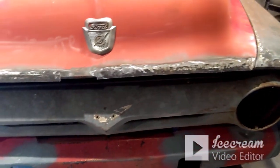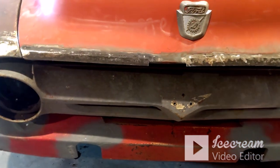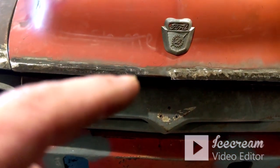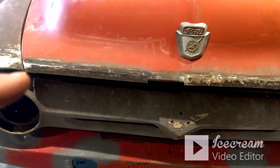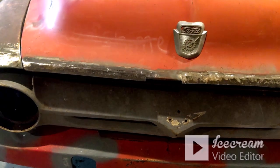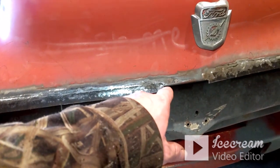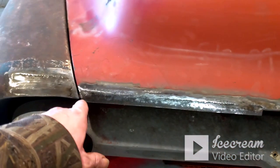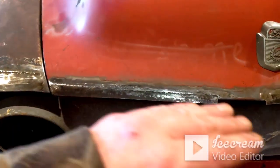But yeah, I wanted to cut you back on and show you how those turned out. I didn't want to have to go through all that and then my piece be too short or something, so that's why I left them a little long. And then I'll come back with a framing square or some type of nice flat straight edge, and I'll just butt it up and get it to where it needs to be on each end. Run me a line, and then I'll know that's kind of where it needs to be cut, and then we'll weld that